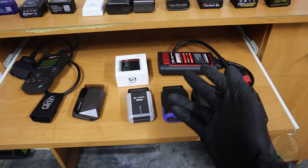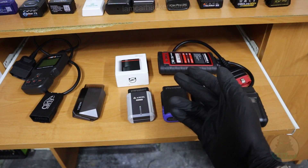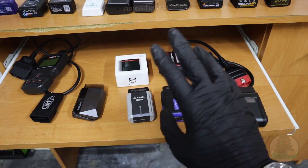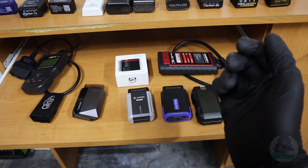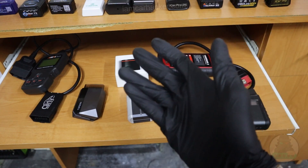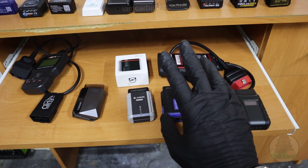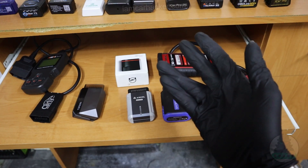For example, changing the battery is not as easy as with an old car where you just swap it. With a new car you also need to do a battery registration service procedure so your battery will actually last 3-4 years instead of 1. If you skip battery registration, your modern car's intelligent battery management system will keep counting with the strength of the old battery instead of the new one, so your new battery won't last very long. Same goes for oil reset — for some newer cars you can only reset your oil interval using a scan tool. Then there's DPF regeneration, electronic brake caliper service, and more. Professional scan tools have 30+ service procedures; these Bluetooth adapters typically have 8-10, but you get the most important ones: DPF, TPMS, airbag, battery, oil interval.